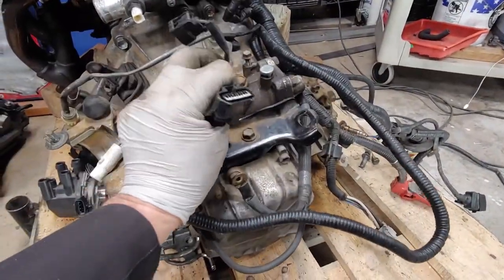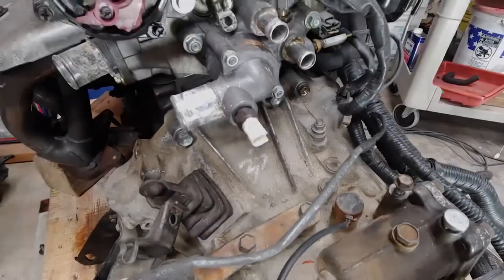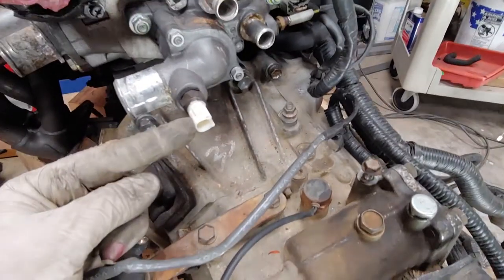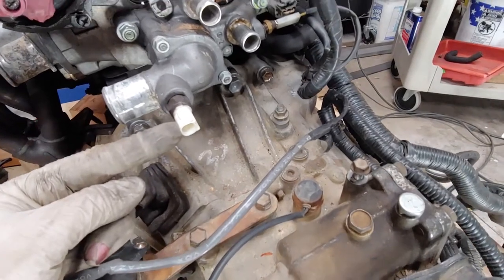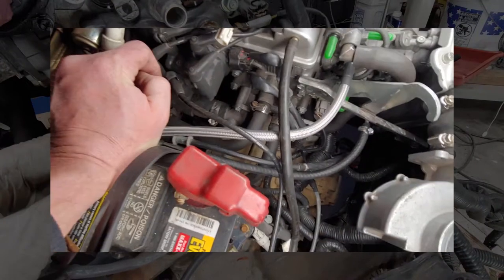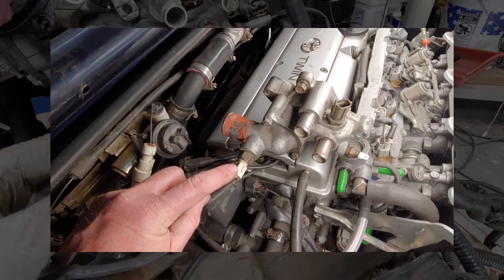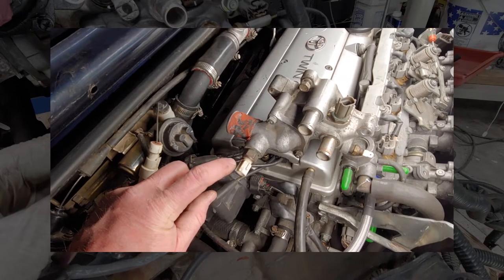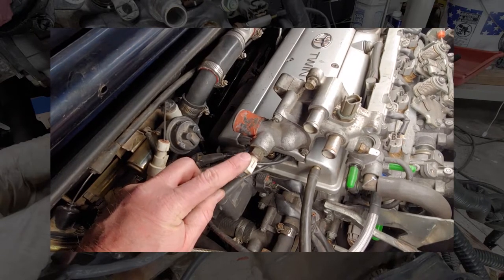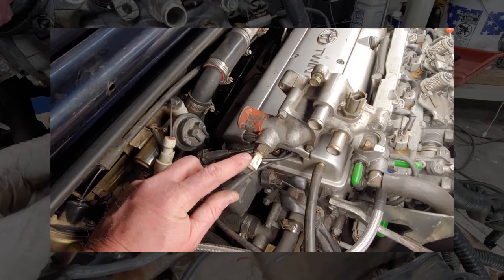These are your coil and igniter. I'm a little mystified by this sensor right here — I don't see a connector on the harness immediately available. As you can see, it's gone. That is the front-wheel-drive radiator temperature sensor. There's a different temperature sensor up at the front of the car, so this one is safe to delete and cap off — you're not going to need it.